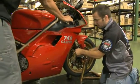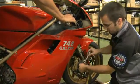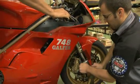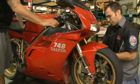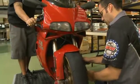Keep in mind this is maintaining pressure so that the brake pads stay in place. Tighten them up on both sides. This may help if you have a buddy around to hold the lever while you go back and forth across the bike.